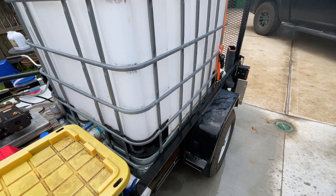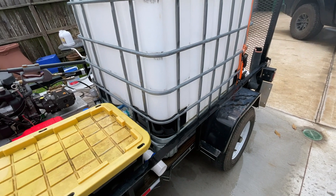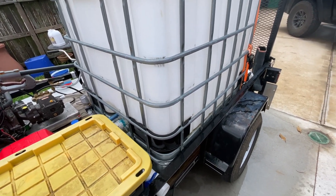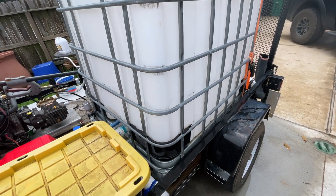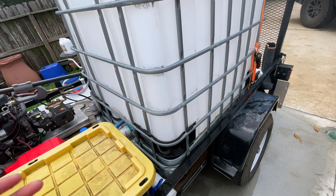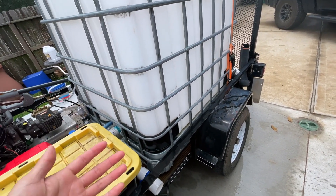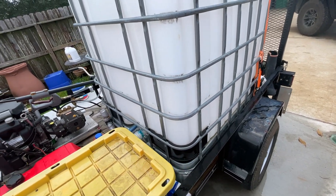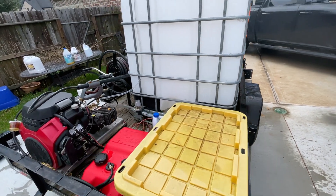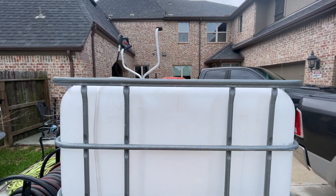The reason I can't fully transport water is because this trailer is not rated to tow over 3,000 pounds, I think, because of the axles. It's really dangerous to tow a full water load because water sloshes around. If you guys don't know that, I recommend you do your research on your trailer before you start transporting water to job sites.